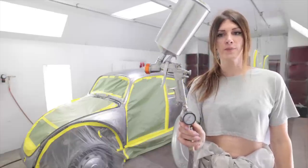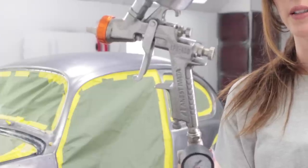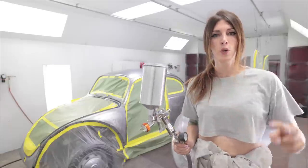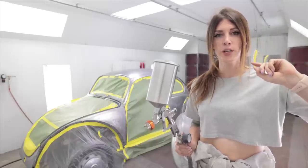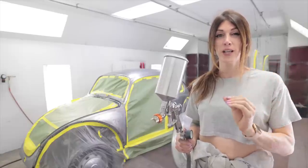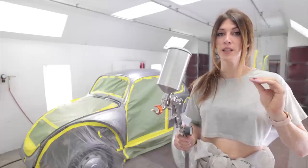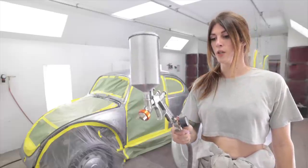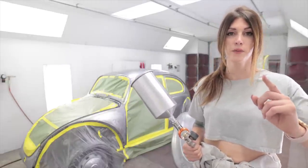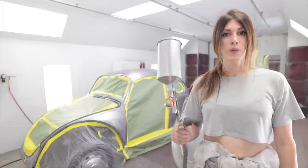This is my weapon of choice — Fred left me his spray gun, it's an Iwata. I used this gun before and I really like it. I'm going to do two coats of epoxy; it's a one-to-one ratio and I gotta let it sit for 45 minutes to an hour to flash between coats. That was Fred's specific instruction, and he's like a paint messiah so I listen to what that dude says — he is really damn good at painting. I gotta suit up and suffer — it's 110 degrees in here. Luckily epoxy isn't really affected by the heat, unlike paint. Without further ado, here goes.